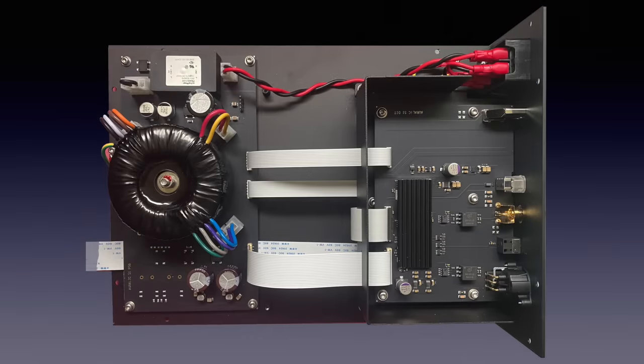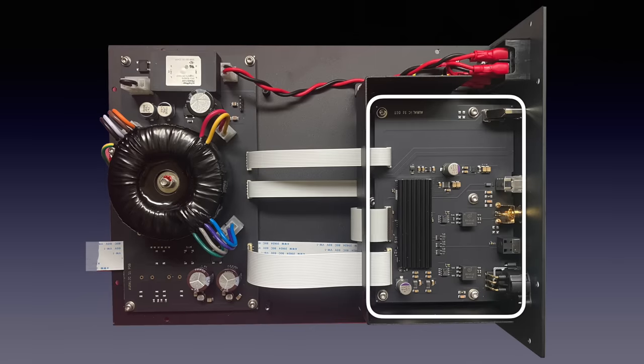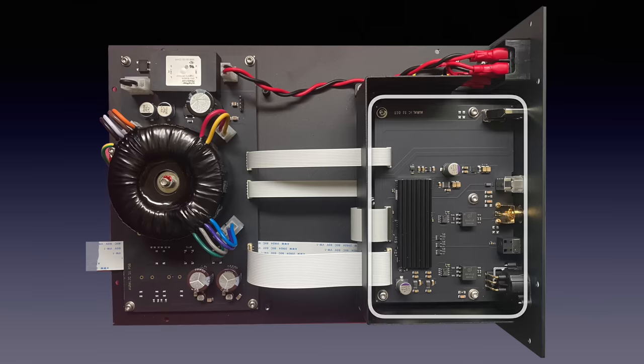When the Ares S1 is opened, the bottom plate and back plate hold the electronics. The linear power supply is situated at the front. From the IEC mains inlet, the mains is sent to a mains filter and from there to the ring core transformer, after which the low voltage AC is rectified and stabilised. In a separately shielded area we find the output board with, out of sight, the input circuit and the Tesla G3 engine. The latter can be found in all new Auralic G2.2 products too and has far more computational power than the predecessor.